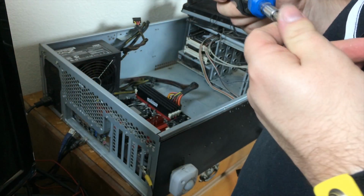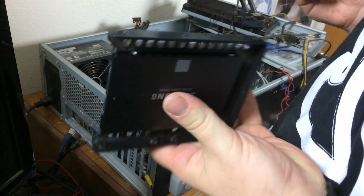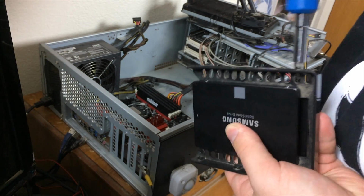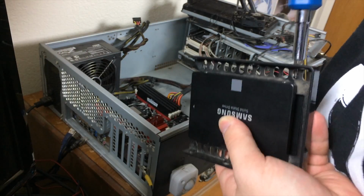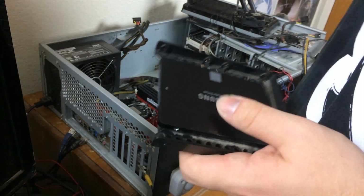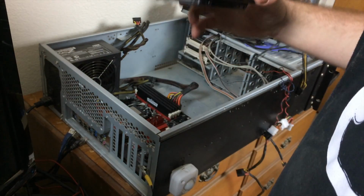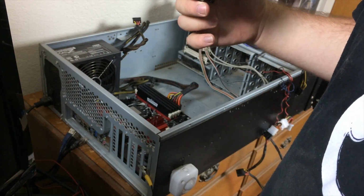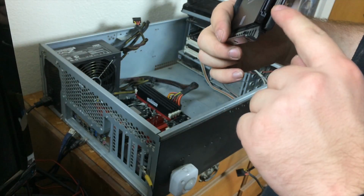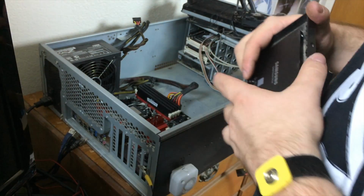Because these SSDs aren't vibration sensitive, I'm only putting in 2 screws each, plus I'm kind of low on screws right now. But I'm not at all concerned about the drives being damaged by excess vibrations of the fans that will be next to them on either side. So now in a single 3.5 drive slot, I've got 2 SSDs mounted. The only tough part is getting these connectors to connect, residing so close to each other.